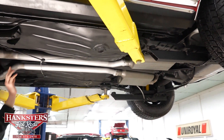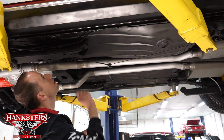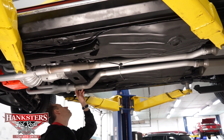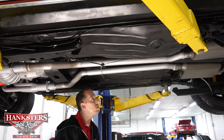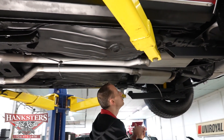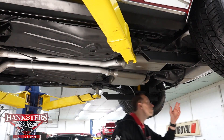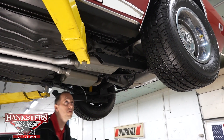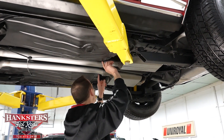Our floors — drain plugs here and there — flooring looks really good at this point. Floors look really good there. Coming back, the input seal looks really good. Our rear differential cover seal looks really good — nice and dry on both of those. We do have some sealer around the floor right here on both sides.